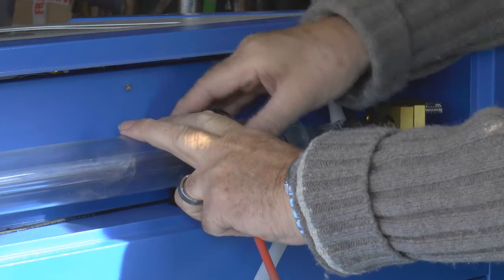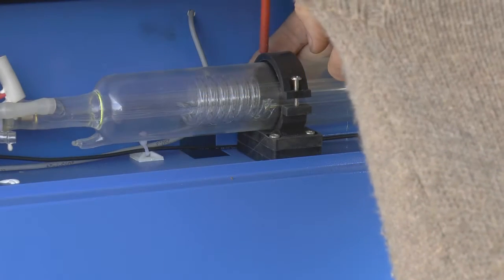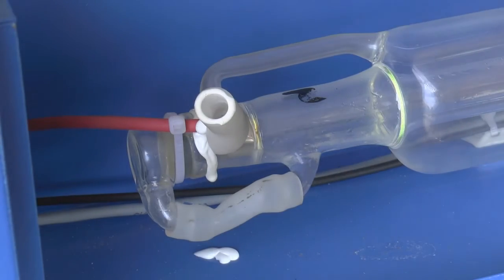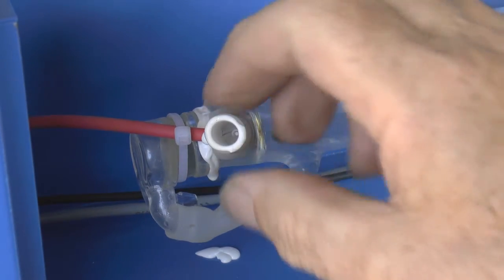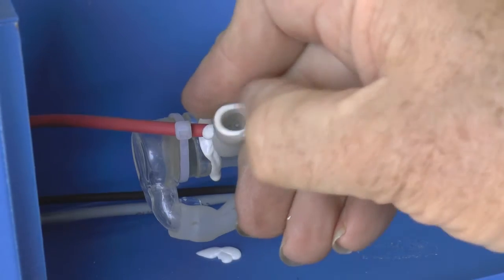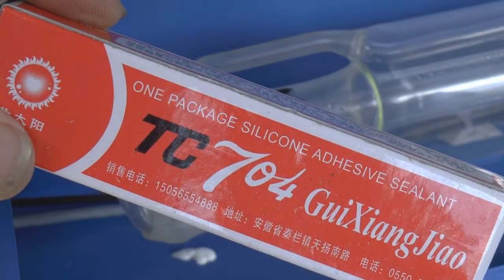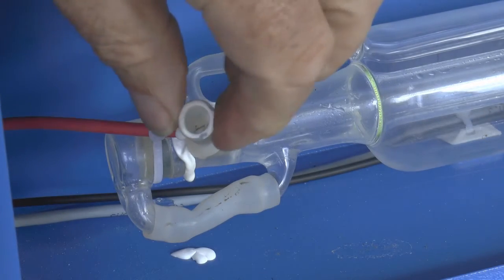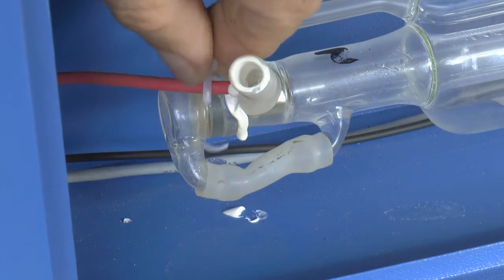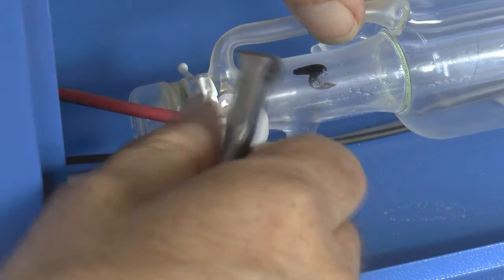I should be able to lift this cap off, and we've got to do the same at the other end. I'll lift this one off as well — which I can. At this point the tube should nearly just lift up. By the way, the machine is already disconnected from the mains. This high voltage connection has got a piece of silicon rubber sitting over the connection, and it's been filled down the inside — looks like silicon rubber material. When they supplied the machine they supplied a pack of what they call silicon adhesive sealant, which I presume is this white stuff here. So we shall need to remove this tie wrap and carefully try to remove it. I don't know whether it will peel off — oh yes it will! I can peel that off — that's good news.